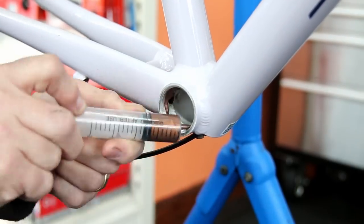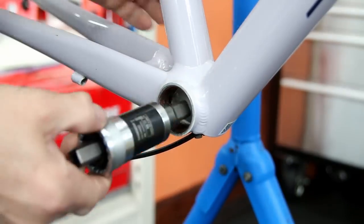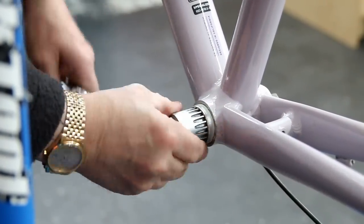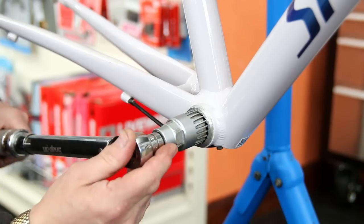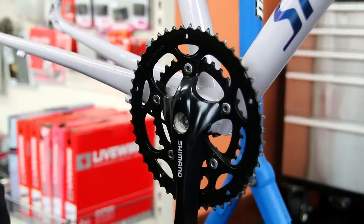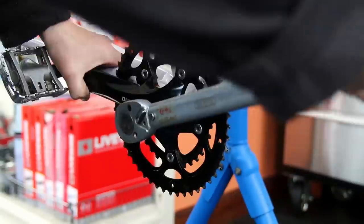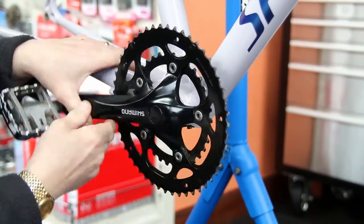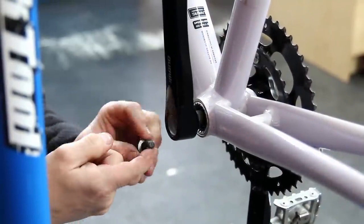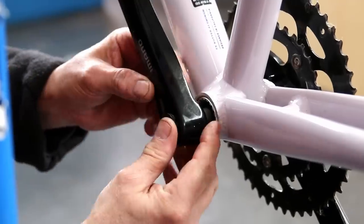We wash down the wheels, which gives me an opportunity to clean the hub, check the integrity of the wheel, check the tyres are rotating in the right direction - lots of little checks even during a simple wash. Then on goes the cassette, which we've cleaned up. We're going to grease the threads of the bottom bracket shell to stop the new one ever corroding into the frame, making it removable in the future. We torque the bottom bracket up correctly, then put the chainset back on with a little general purpose grease on the shafts to stop them binding and causing issues with removal in the future.